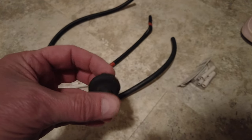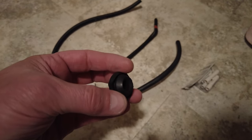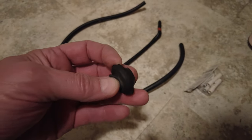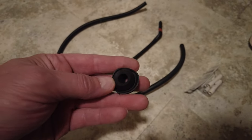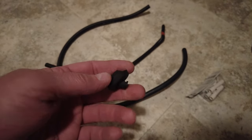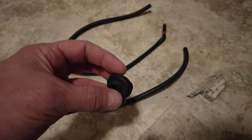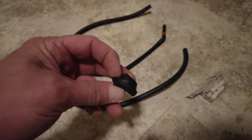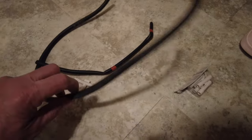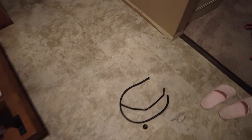O'Reilly's Auto Parts got me new fittings. My issue is the grommet — there is no way I can push this grommet back in like this. What I'm proposing is pushing it in from the front side of the inside with some silicone grease around it. I can't push it out from the inside because I can't get my fingers up in here without cutting a hole in the metal, but pushing it in from this direction should work. It's actually fuel line, not vacuum line — a piece that was already cut.